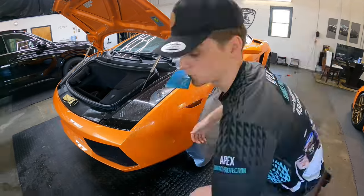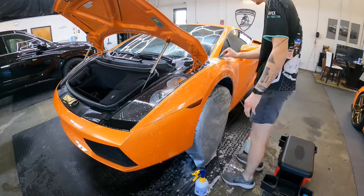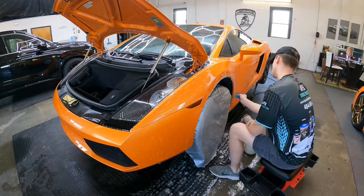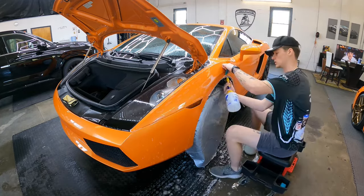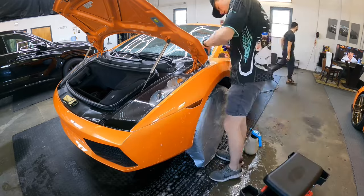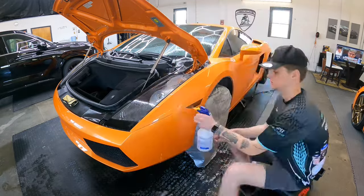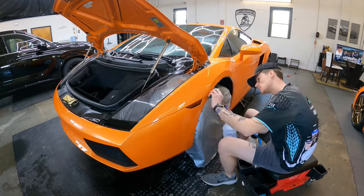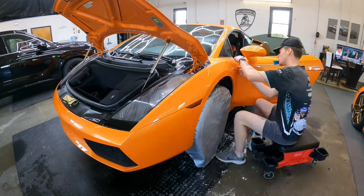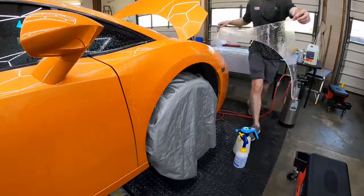After the hood we move on to the fenders. The fenders are going to be a plotter cut, or a pattern install. You line it up, find your tack points, make sure everything is lined up and the pattern works. This is an older car, so we're going way back when it comes to patterns — and hopefully they've been adjusted to fit perfectly. There are all sorts of software companies such as DAP or DigiCut; we use Core for our software to print out patterns, so we do a combination of bulk and pattern install.